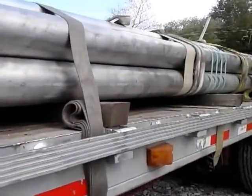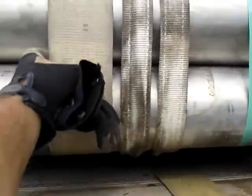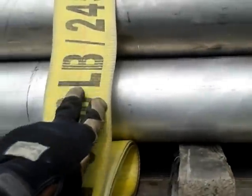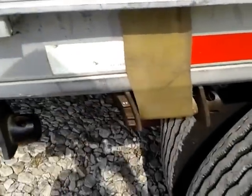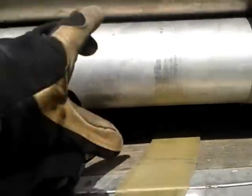Flatbed 101 when it comes to hauling tubing or pipe. Every so often you'll need to stop and make sure all these cinch straps are good and tight. If they're loose, you tighten them up and then you loosen these outer straps that hold all the load down, and then you tighten them some more. I used the cheater pipe as well as my load bar on the ratchets and on these cinch straps in order to make them good and tight and pull the load all together.